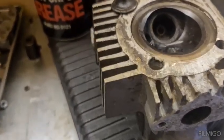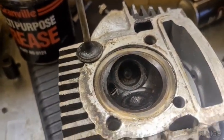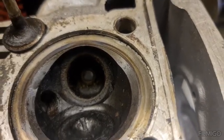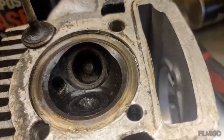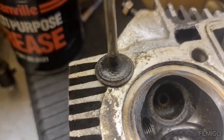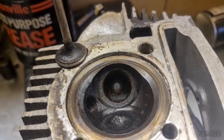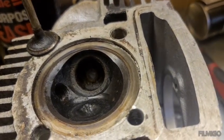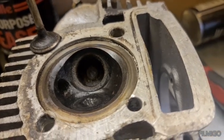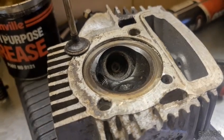I've pushed on a bit further, took the other valve out, and that's what we've got. As you can see, that one is full of crud as well. So we'll just go through the same process as before - cut the valve back in, hopefully that way the head will seal properly and we'll get full power out of it instead of it losing gases, making it hard to start and all the rest.